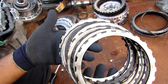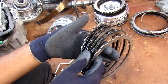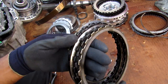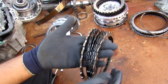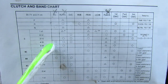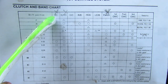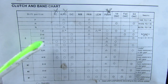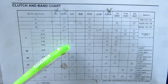The real reason why clutches wear out is: either your fluid is incorrect or you have the incorrect fluid level, causing slippage that wears them out faster; or if your fluid is dirty, contaminants can grind and cause wear; or if the transmission isn't designed correctly or is under a lot of strain these will heat up and literally burn out. Driving style also matters — shifting very abruptly makes the clutches engage and disengage quickly, accelerating wear. Now, out of the three burnt-up clutches — the input clutch, high-low reverse clutch, and forward brake — the input clutch was the most burnt and took the most damage. Cross-referencing with the repair manual confirms that fourth and fifth gear relate to the input clutch.